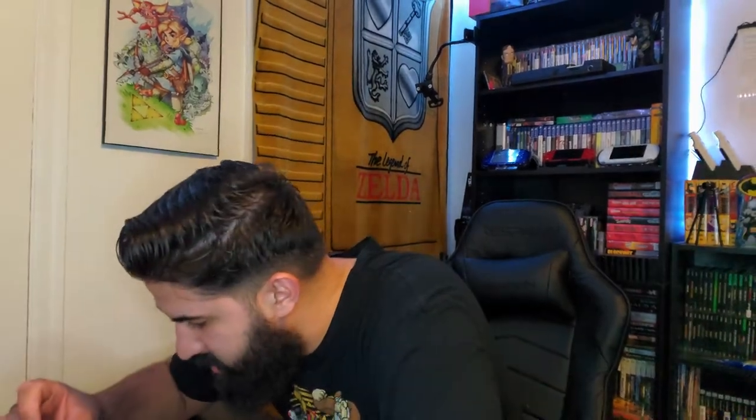We're gonna remove this label. I've actually heard that people leave that label on there and they complain about temperatures. Take this out for now. Need to be able to screw it on. Let's apply a thermal paste. I'm a believer in the nice pea-sized drop in the middle.